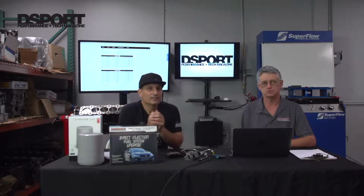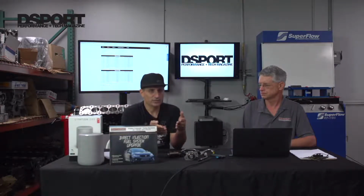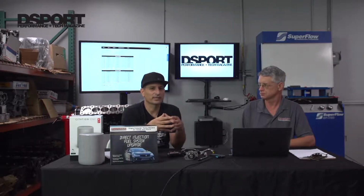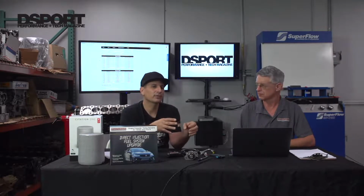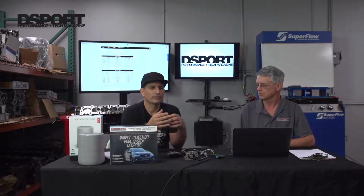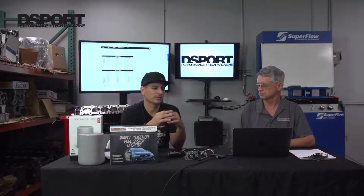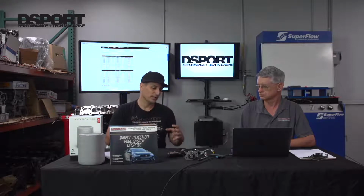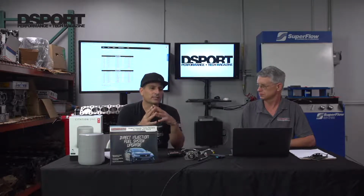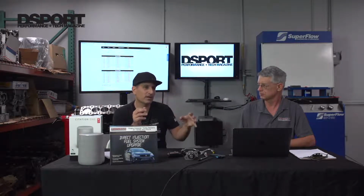Yeah, go ahead. Any carbon buildup problems? Well, that's what Doug was just talking about. A lot of times on direct injection engines, as we talked about before in the magazine, intake valve deposit accumulation is something that occurs. And a lot of the European models that only have direct fuel injection, we've seen that firsthand with a VW 1.8 liter engine coming in here and just being built up all over the place with the intake valve deposits. What Doug was saying earlier is that Honda's cam timing is such that they do a good job of helping some of that fuel come back up into the back of the intake valve and keep things clean.